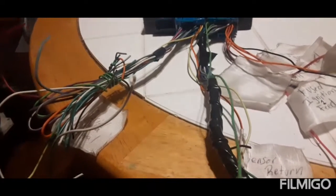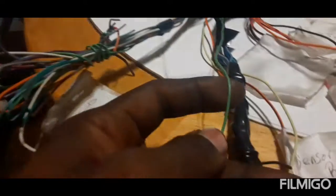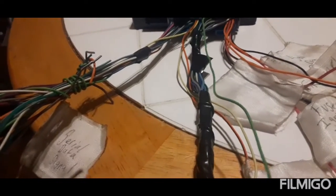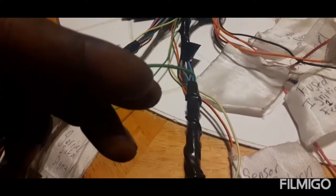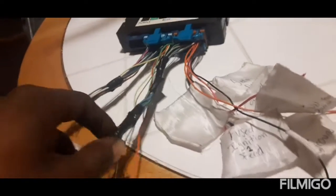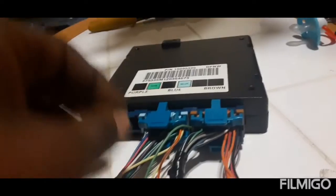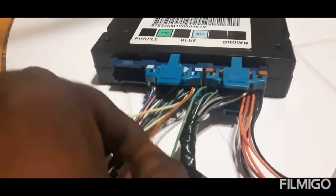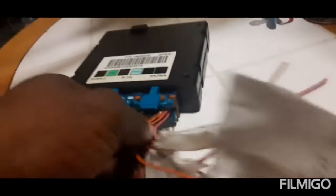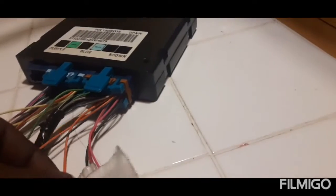The green wire — I don't have it labeled — is also a serial data line. I'm 100% sure it's going to be the OBD2 connector, so I'm not going to worry about that. The brown connector wires are things you won't be needing in this swap. So in the blue plug it's only two yellow wires and one orange and black wire that matter.